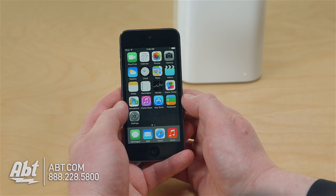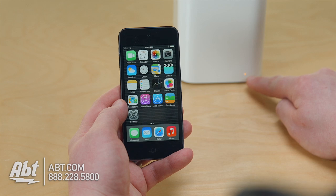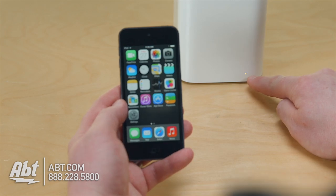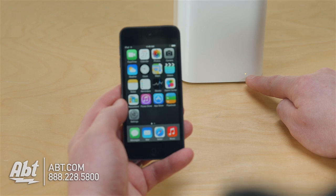We're using an iOS device to set up our Airport Extreme Base Station. As we can see, this blinking amber light means that it needs some help — something's not set up or something's wrong. You might see this in the future after you've set it up and things are working great, but maybe it needs a firmware update and it's going to keep blinking until you fix it. That's what a blinking amber light looks like.